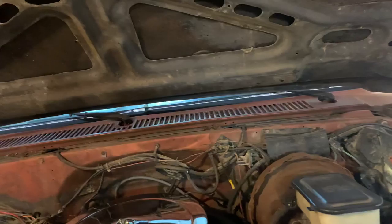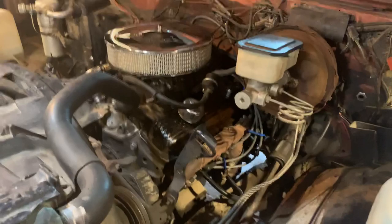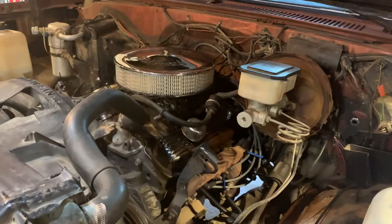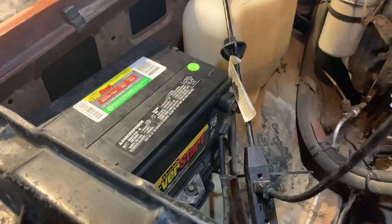All that was really wrong with it keeping it from running was the PCV valve was unplugged — they just didn't realize it, because it would start but ran like crap. After that I started doing small stuff: spark plugs, oil change, coolant change, replaced the oil sensor because the oil pressure gauge wasn't working, put a new filter on it, did new valve cover seals, and bought a new battery. The battery from the field actually lasted me four months without a charge.